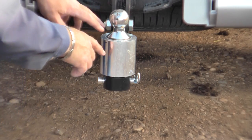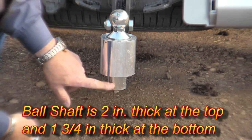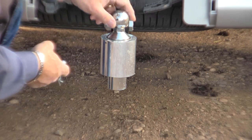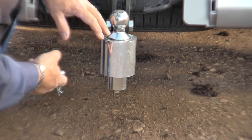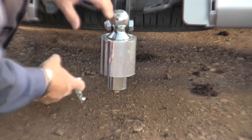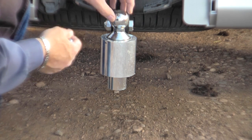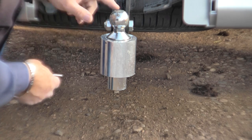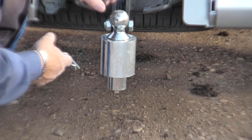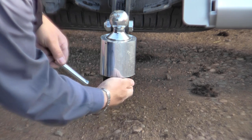This pin goes all the way through and you can see how thick the shaft is — that's one piece, the ball, through there. Inside this ring is the brake lining. That's what actually grabs the ball for sway control with the weight distributing hitch. It's cone-shaped — the brake lining is cone-shaped, the ball shaft is cone-shaped, and that's what grips it. So your ball actually stays with your trailer and swivels inside the base in that brake lining. That's what the pressure is applied against — that's what controls your sway. It's a very unique design from Anderson Hitches.